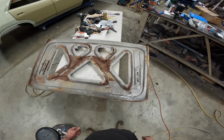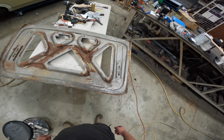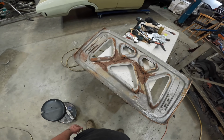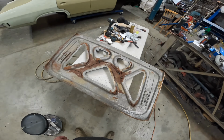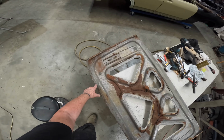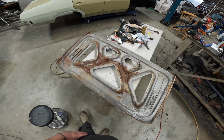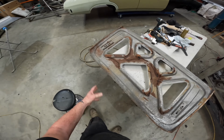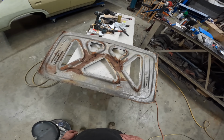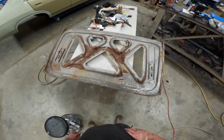And in essence, probably sending this away to get dipped was a waste of money. However, I didn't know that in the first place. I was not planning for it to come back so ratty, like with the holes, that is. So yeah, in hindsight, probably could have just got away with leaving it as it was, saved a couple hundred bucks and just simply did what I just did: remove the skin, clean everything up with a sandblaster and put a new skin on. So lesson learned, hopefully.